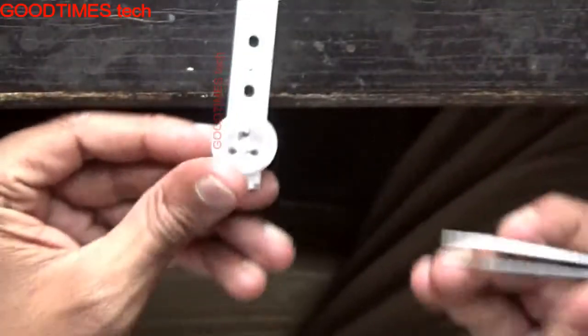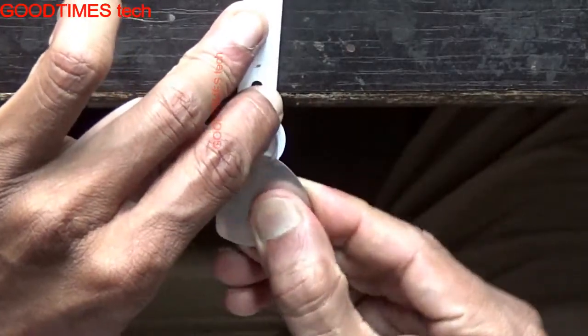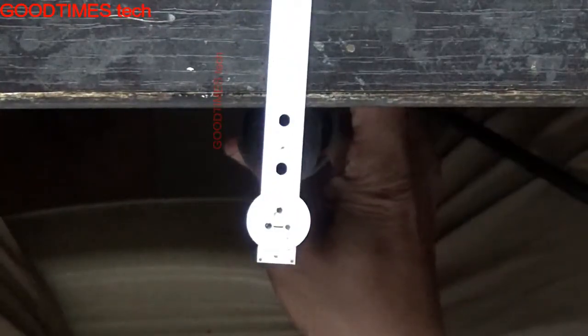This is the LED — you could call it the defective LED. I'll show you how to remove one more LED from the other side, from the edge here. Let's take this out gently. Heat it a bit from the bottom.